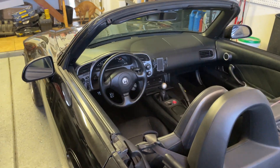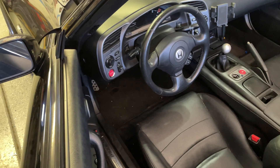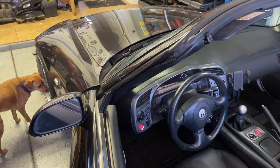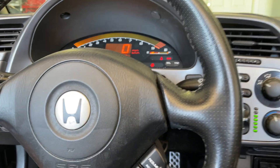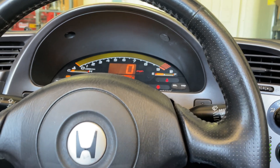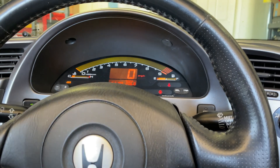The Science of Speed kit is really, really refined and nice for that, so let's get to it. First thing to do when you are working on fuel system stuff, especially installing the injectors, is you want to pull the fuel pump fuse, which I believe is a 15 amp under the dash, let it run for a minute to drain everything out of the fuel rail. Looks like that was it.